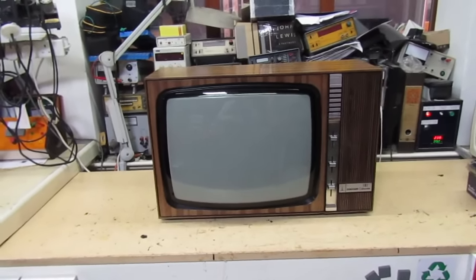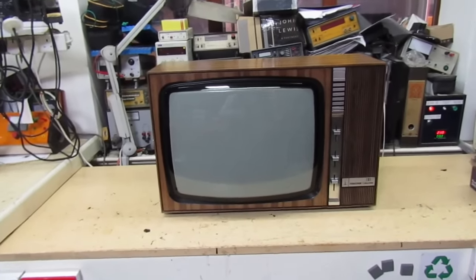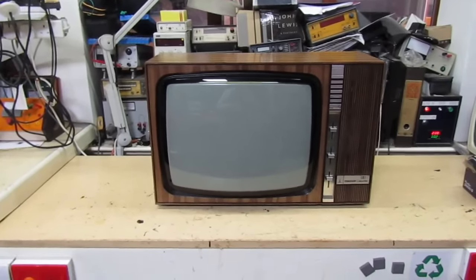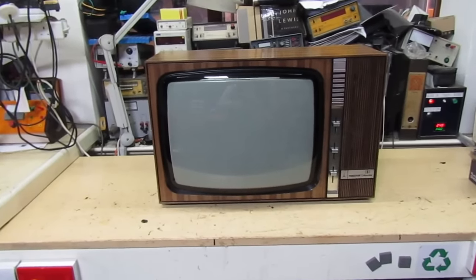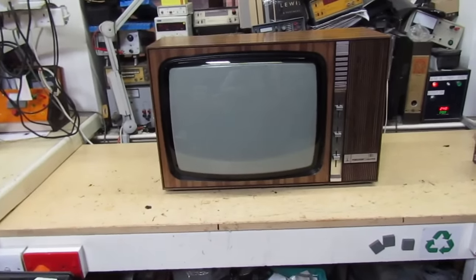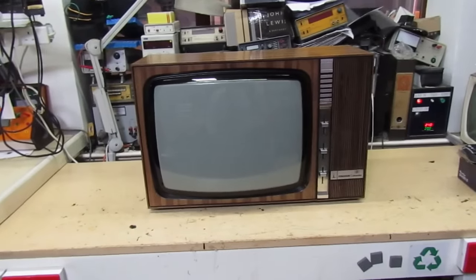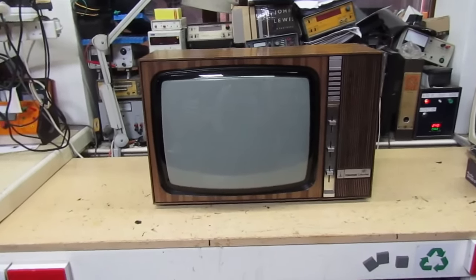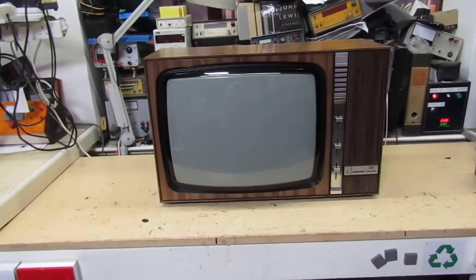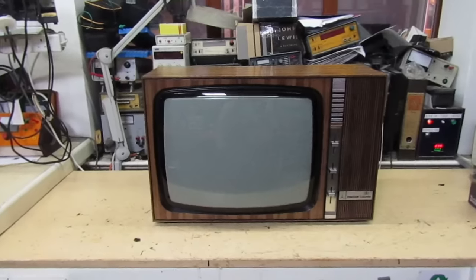Changing triplers in these was a very common fault. The last telly I ever repaired was only about 20-odd years ago - an old lady rang up and I went round. I was absolutely horrified to see one of these in the early millennium, around 2000-2002. The set was dead, but luckily I remembered a stock fault: a little tantalum capacitor on the decoder panel that decoupled the 25-volt rail would go short circuit. That's exactly what the problem was, and I fixed it. Although this set dates from 1976, the tubes weren't particularly good on these - they didn't have a very long life.